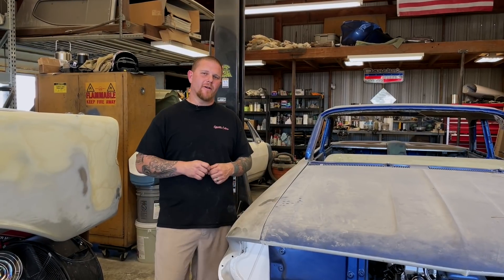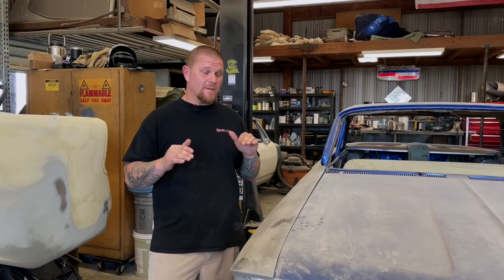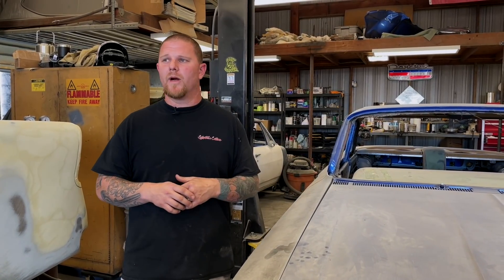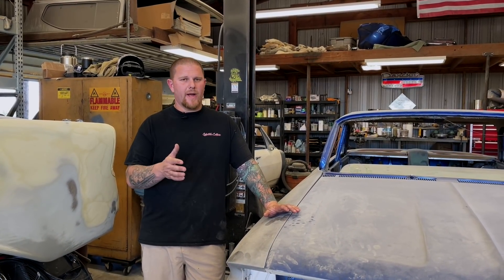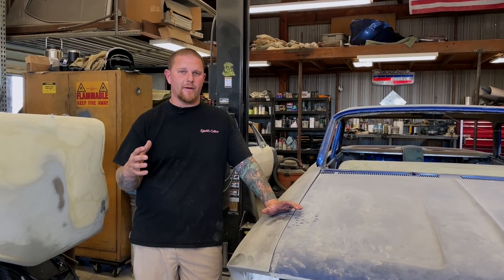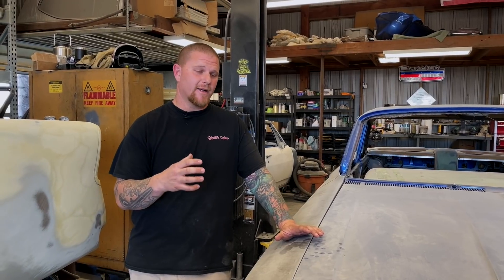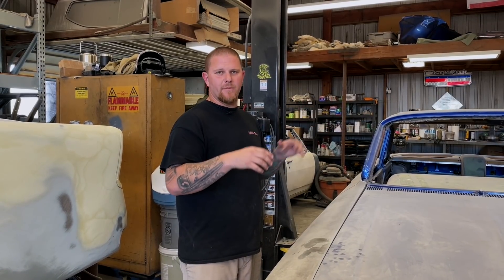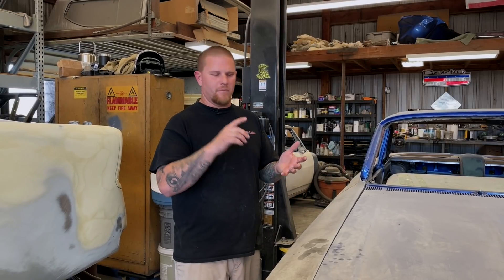What makes this video good for you? We're going to talk about all the videos we're making on how you in your garage can achieve a show car quality finish and a full build. We're covering everything from metal finishing — hammer and dolly work all the way to a mirror finish on an existing panel — discussing how to move metal, how it expands and contracts, how a shrinking disc works, torching, and the pros and cons of all those processes. Then we'll have a video on metal shaping, where we take sheet metal from a flat sheet and create a fully customized engine bay, covering planishing hammers, bead rollers, English wheels, and all those processes.